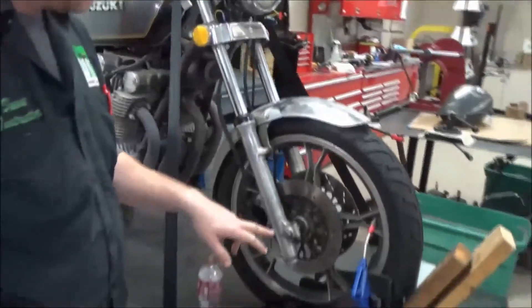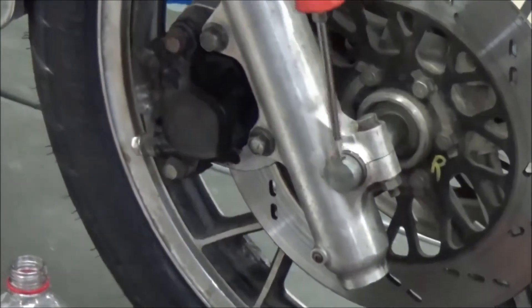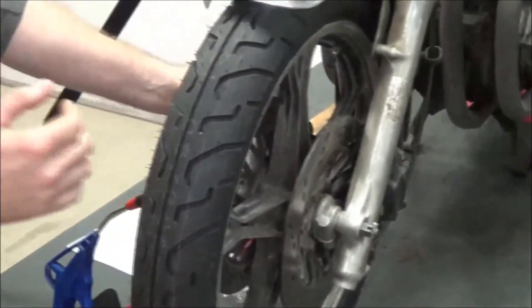Just did tires on this bike. You can see the axle orientation where this hole is facing up. What that hole's for is where you put a screwdriver in it, then sneak around the side and use your torque wrench to tighten up the axle.